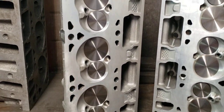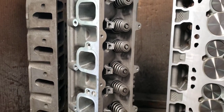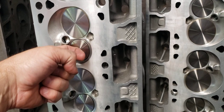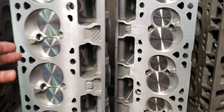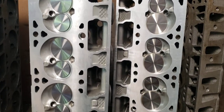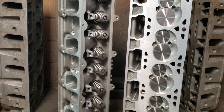The next step back would be stock intake valves, stainless steel exhaust valve, seats, and guides. Trying to go back from that — in my opinion, you're taking your life in your own hands running the stock exhaust valves, because the hollow stem runs all the way down to the valve head. I wish I had one here where it was broken. They're not sodium filled or anything, but just behind there is where the actual hollow stem comes to — there's really no strength there. As things get hot, things move around, guides get worn, valve float and all the other things, they bounce on the seat. There's really not much at the end of the day that you can do to save that stock exhaust valve. Maybe you could get a super soft lobe and run an extra 15 degrees of cam duration to make the same power, but that just doesn't interest me.